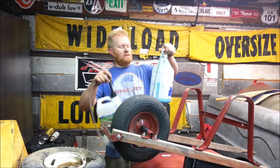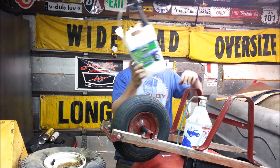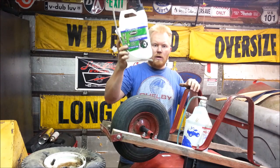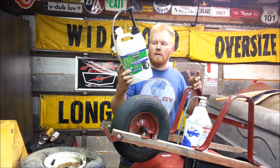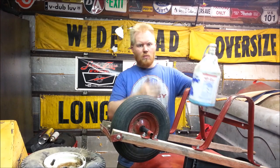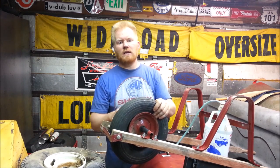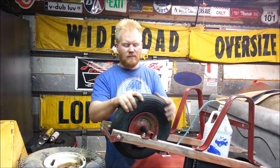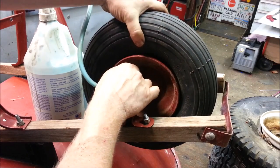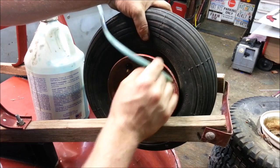What I like and what I use is tire sealant — the kind you pump through the valve stem. Slime is the ultimate brand, the one that everybody knows. Not the best, not the worst, but equal to everything else. Slime is the brand you can find anywhere. I use some other brands as well. What you do is essentially inject it into the tire. It has cotton fibers and other stuff that lodges in holes, goes out partially, and seals them up. The stuff claims it seals quarter-inch holes, and it really does work.